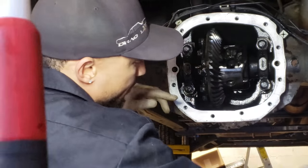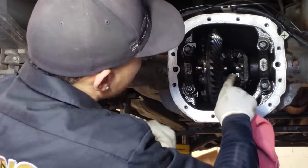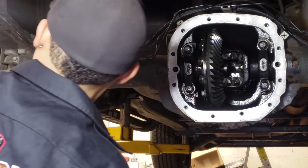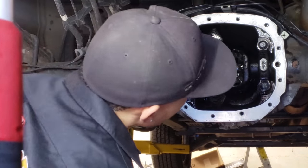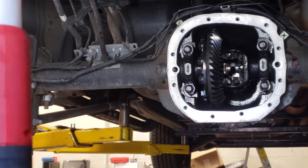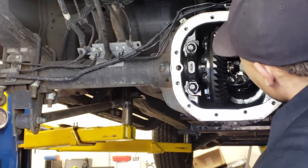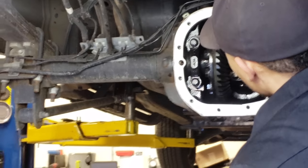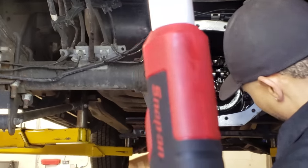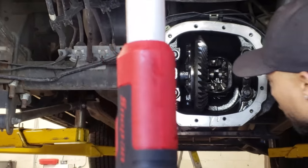We're going to slide that out and rotate this back down. Okay. Now we're going to push the axle in. Now we have access to the C-clip, to the actual C-clip. Take your little pocket rocket screwdriver, rotate them around and give them a push. They'll fall down in there. Grab them, put them to the side on maybe a clean paper towel or a rag, because you're going to be using them later.